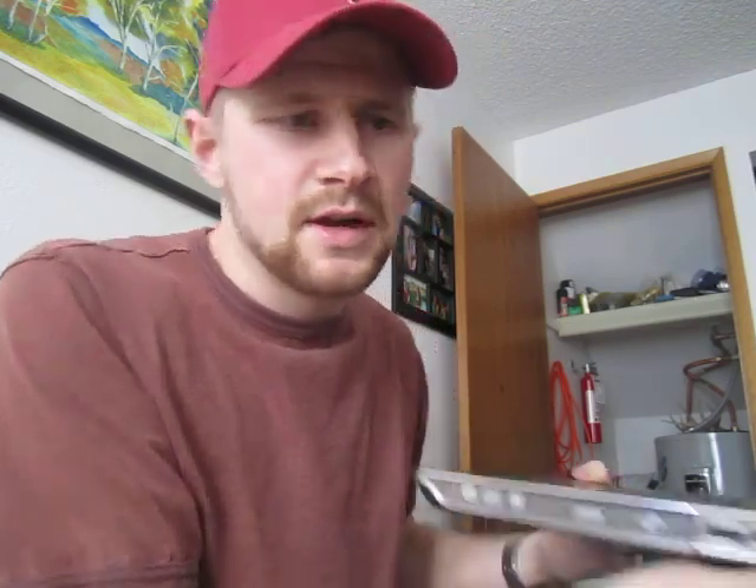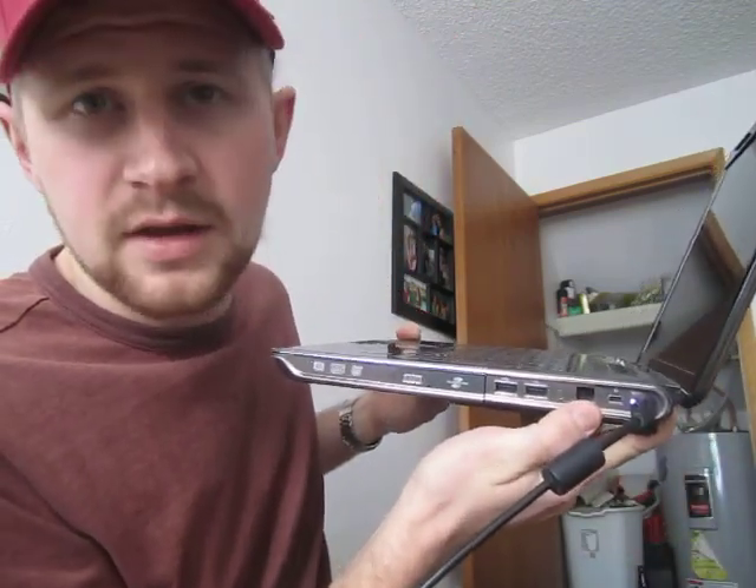As I was looking into it, I noticed that this computer has an RJ11 port — that's this guy right here — which is just a standard phone jack. There's no point in having that for me on this machine because I have an ethernet port, so there's no real point ever to connect it to a phone line. Since that's just a wasted port, I might as well get some use out of it. So I made this cable here — it's just a standard phone jack cable — and then I connected it to a button. The idea is that I rewired the laptop so it can get powered from that switch.